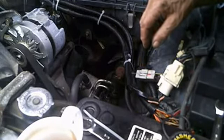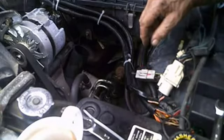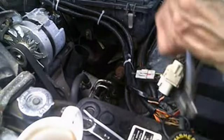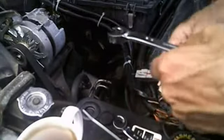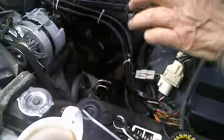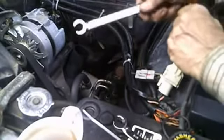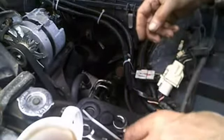I think the best bet is to get the old vice grips out, or just get the old hacksaw, cut the line, and get a deep socket on it. Probably would be the best bet. What about the actual power steering pump? I thought I had me a set of... okay, see, there's a good example right there. That was a 5/8 line wrench, which would be equivalent to your 15 millimeter.